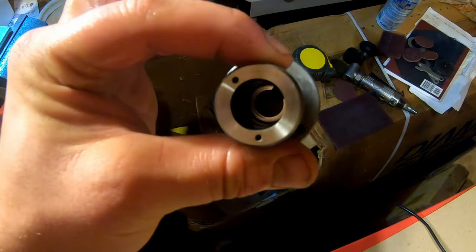Now we take our plunger, give it a little twist. It's from the oil. Make sure that slides smoothly. A little bit more oil here. That's what I'm talking about. And our spring. So a little oil on the inside of this. This piece and this washer go together. And then from the bottom, so countersinks up, this goes in here. And then I just use that same tool.